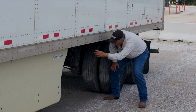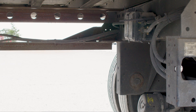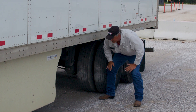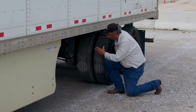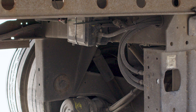We have a whole airline system that runs from the front of the trailer to the back. It's secured with tension springs. These airlines must be 18 inches minimum from the surface of the road. Underneath here, we have our slide rail and our locking pins for our fifth wheel release. This is an air bag trailer, so it has an air release system on the tandems. Get down and under here and check your brake drum, your whole suspension system, your shock absorbers, your cross members, your torsion bar. Make sure there's no audible air leak.